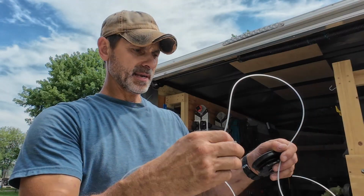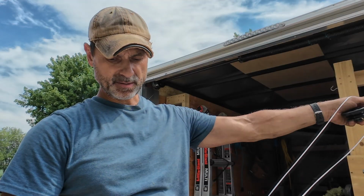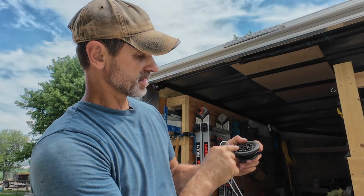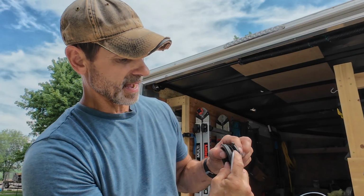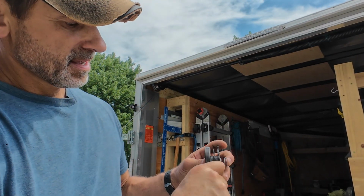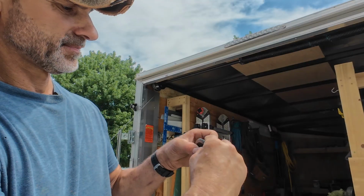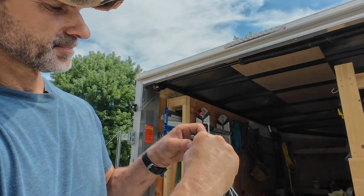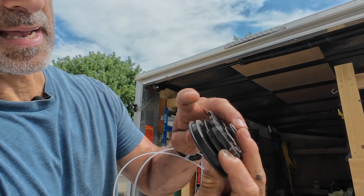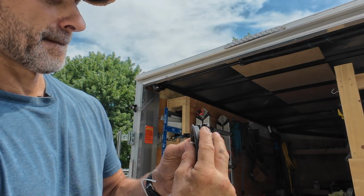So then you take your line and you fold it in half. I'm just gonna have to change my string out a lot sooner because I have such a short piece. So you take your line and the direction is this way, points this way. So I'm going to take my line, and there's little slots in this center area. You hook it in that slot and you start winding that direction that the arrow indicated. Okay? So you keep your sides separate and you just wind it up.